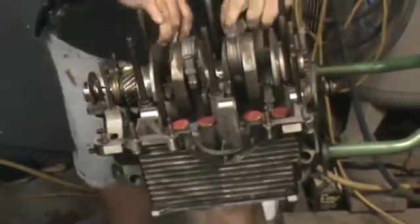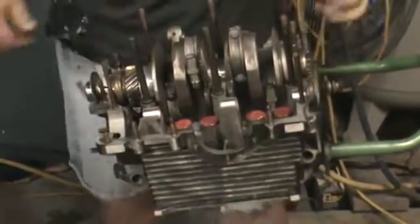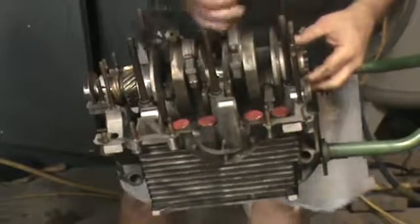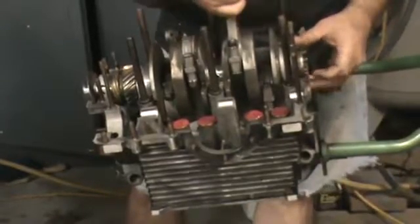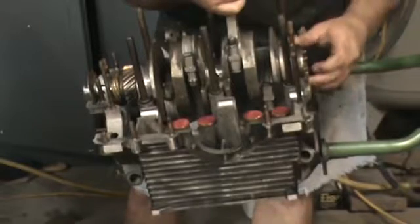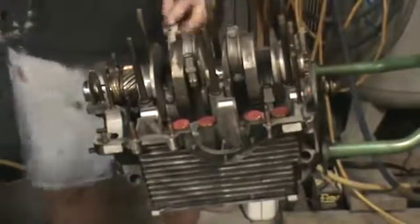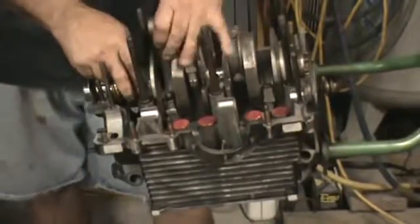Good. I'm gonna lay the rods off to the side. Like I showed you guys, I got my bearing marked in the back here, so I'm gonna rotate my bearing. You wanna use this back rod as a handle. Rotate the bearing until it drops in. Boom, boom. Lay your rod back over. Use this rod as the handle on the front.